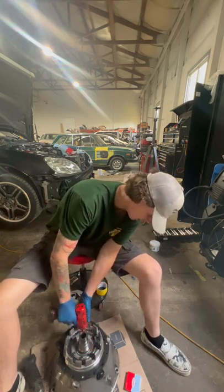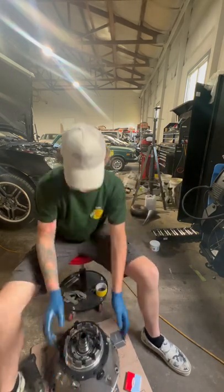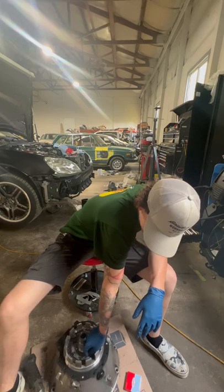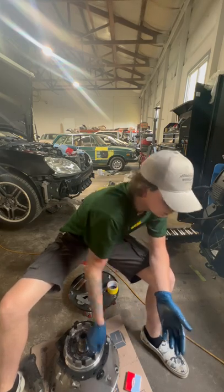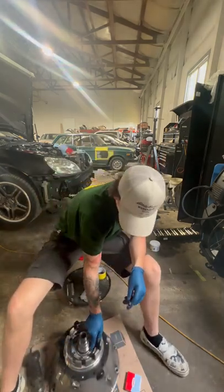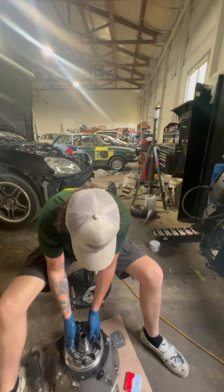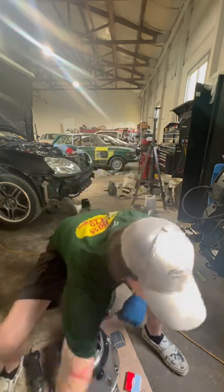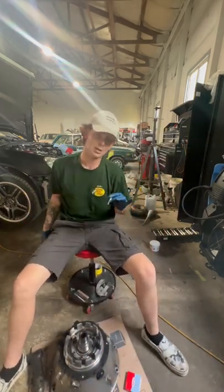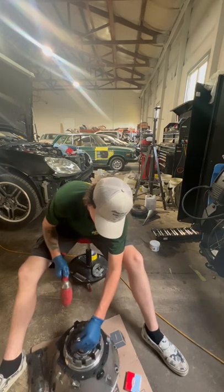The torque spec for these is very light. I don't know it off the top of my head, but I will put it in the description for any of you tackling this job at home. Hopefully if you're watching this video you're in a shop and you have Pro Demand, AllData, or something of that capacity so you don't have to worry about it. You're gonna want to be careful here — don't lose this guy. It will come off; it rarely does but it can and it has happened to me. So take your time. You're gonna take a little blow here — we're not gonna hit anything in the transmission. I'm gonna take the top of the bolt and just give it slight taps to move it out.